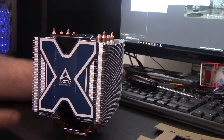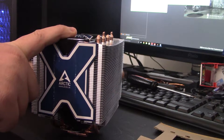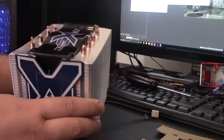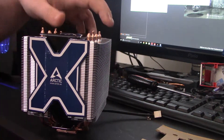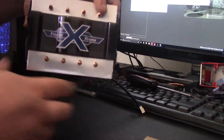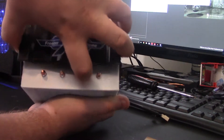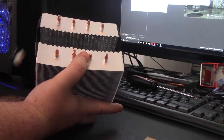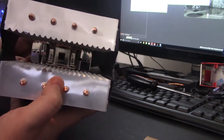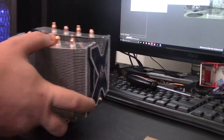It is a really beefy cooler. You have two towers with a single fan here, which is pretty nice. I think this should perform pretty well. Looking at the heat fins and heat pipes, nothing super crazy. What happens is you squeeze both sides of the fan here — let me show this on camera for you guys — and you can pull it right out. That's essential because for AM4, you have to screw down and having access to that is definitely really important.